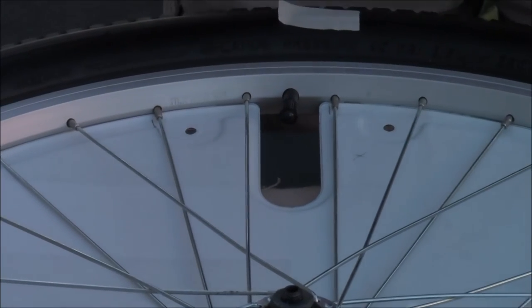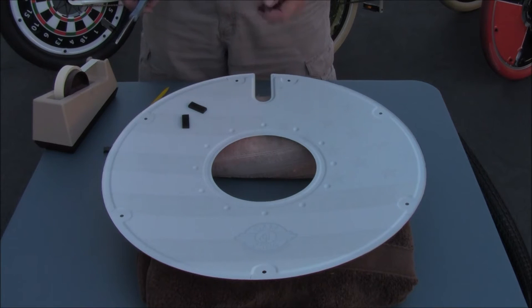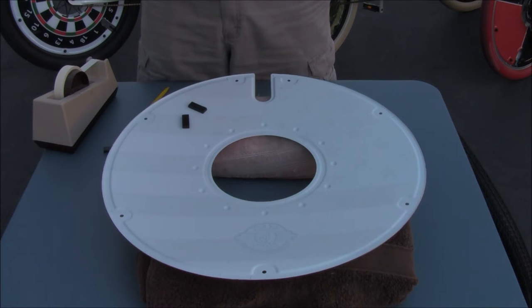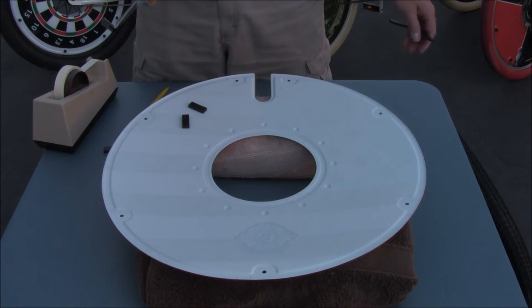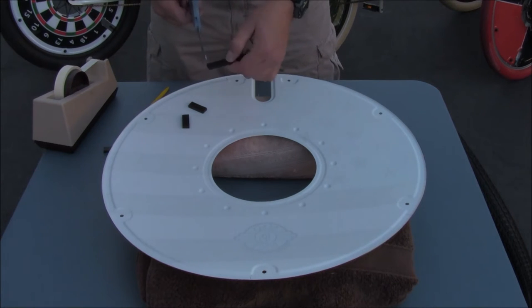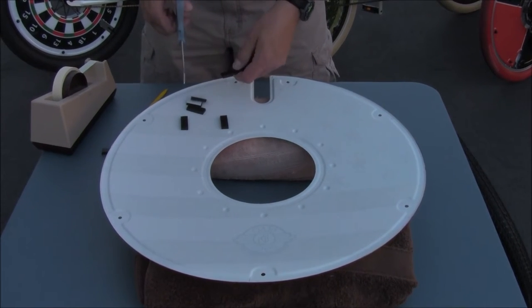Next, let's place our tape around the edge. Before we can place our foam tape we need to cut it — you're going to have strips of foam tape that come in your kit. Be careful not to cut it too long because you only have so much in the kit. There are seven marks we made, so that's seven pieces per disc, 14 per wheel, and 28 for the total bike. We're going to take some scissors and cut the foam tape to approximately one inch or 25 millimeters.